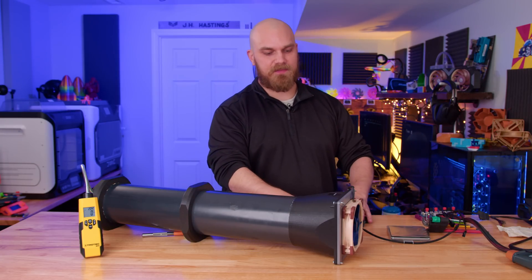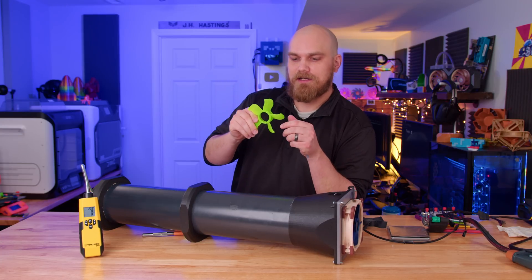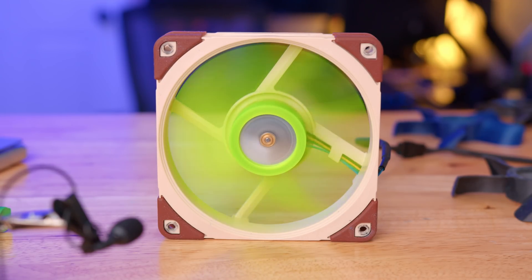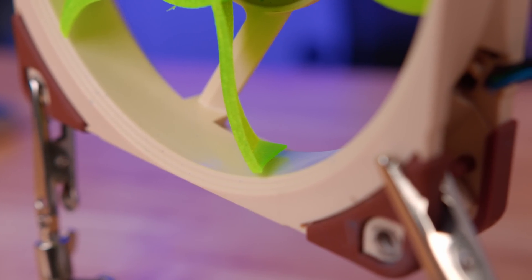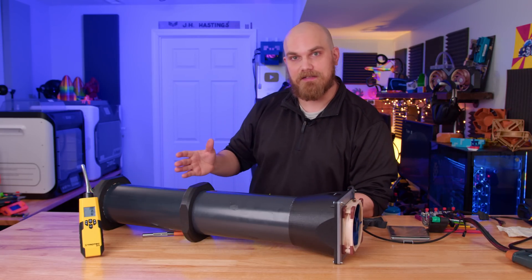They all sound pretty much the same with the exception of the TPU fan. Initially when you turn it on it sounds just like the other ones, but as you let it run you'll notice a progressively louder and louder sound. I don't have a good enough high-speed camera to see what's going on, but I would guess that the little winglets on the end of the fan blades, as the fan spins around and around, slowly succumb to centrifugal force and start touching the fan frame — which is why it gets louder and louder.